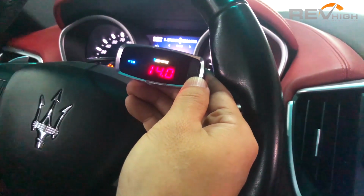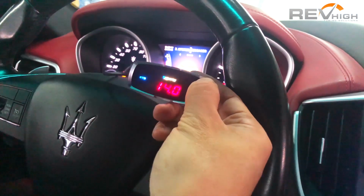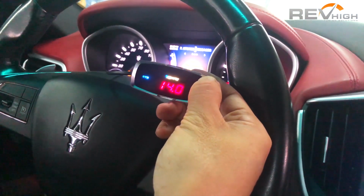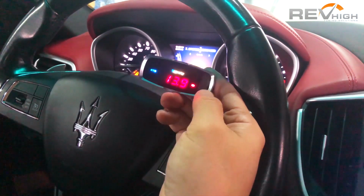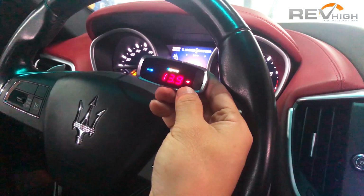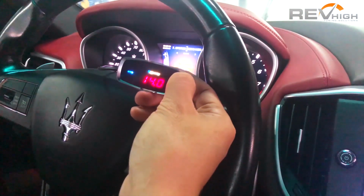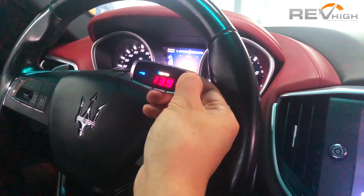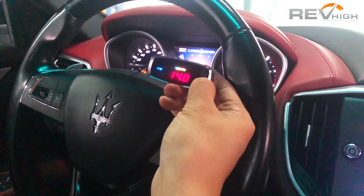I will show you how to activate the anti-theft. Just on standard screen, hold the top arrow, and after a short while you see a little lock symbol come on. So if you go to accelerate now, you won't be able to accelerate, even with the car turned on, and even with the keys in the ignition. Now if you want to turn that off, same thing, standard, top arrow until the little light turns off.